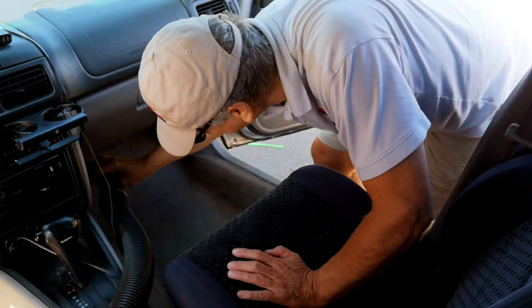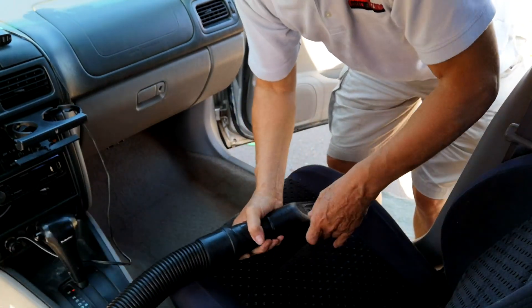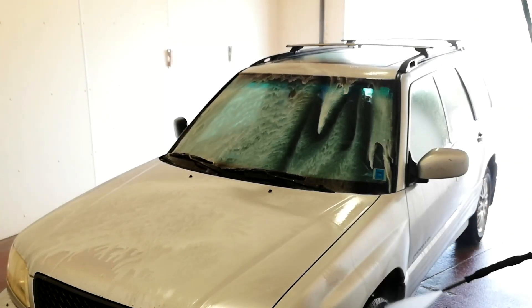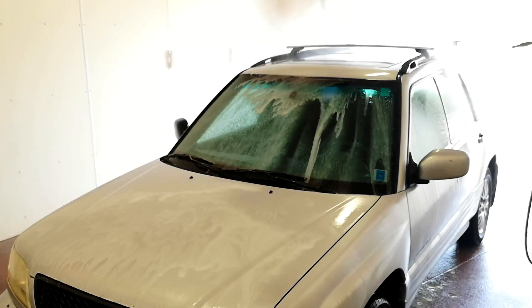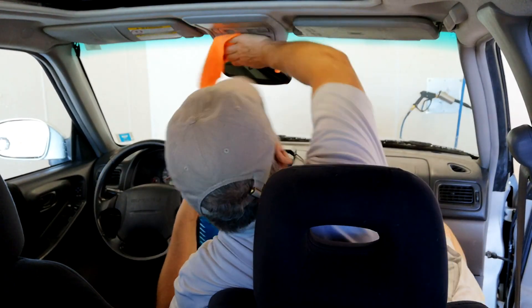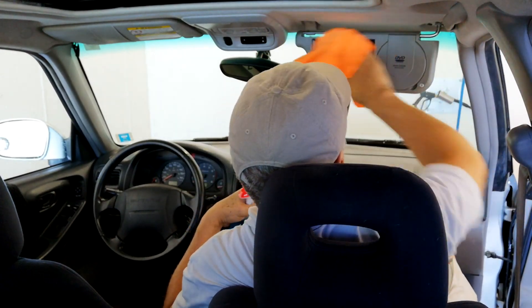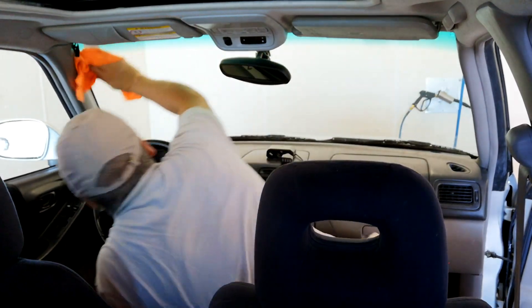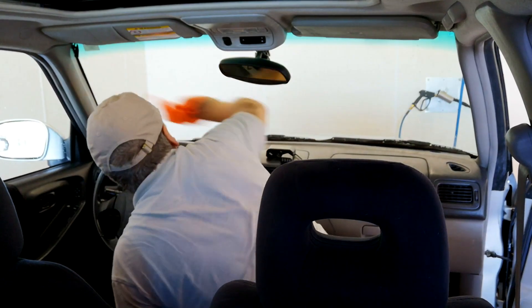The first step in the process is to clean the vehicle. How clean does the vehicle need to be? The rule of thumb is that you have to clean up the source of the odors, then do a general cleaning, and then apply the ozone. So if somebody vomited in the vehicle, for example, you'll need to clean that up first before you use the ozone. It's really just common sense — if whatever is creating odors is still in the vehicle, you can put ozone into the vehicle all day long and the odors will just come back.